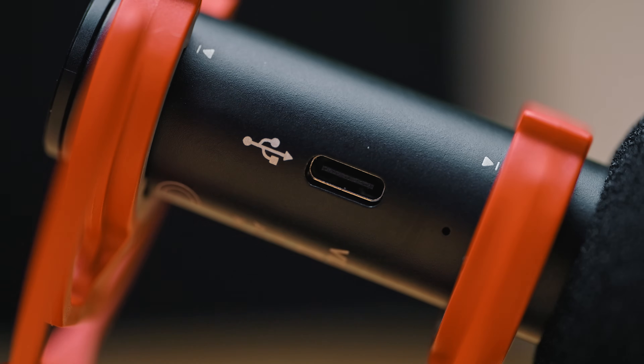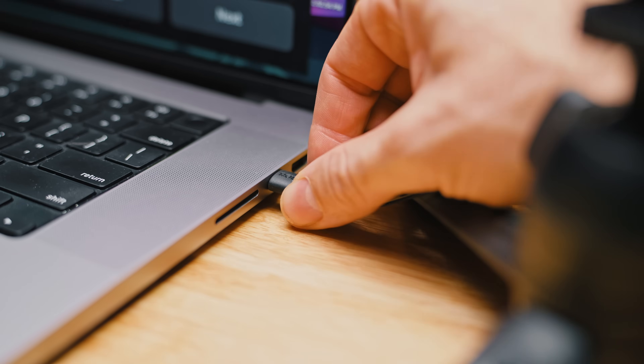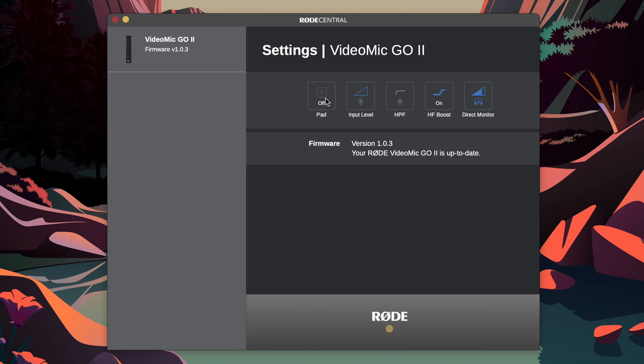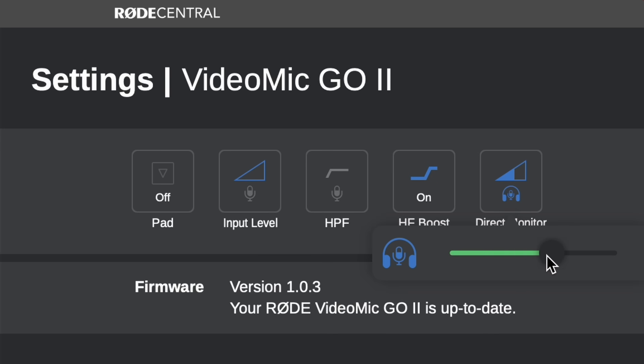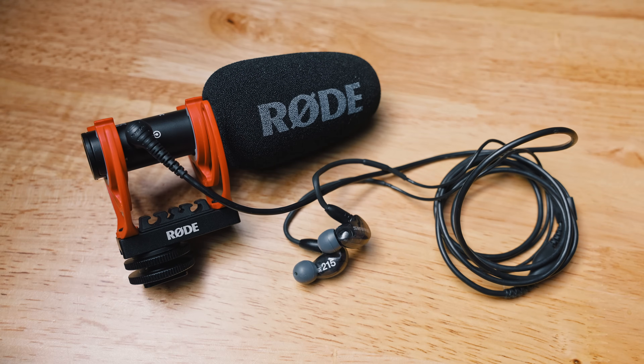There are some hidden features you might not notice right away. For example, if it has no battery, why is there a USB-C port? With the right cables you can connect this microphone to your computer and use it as a USB microphone for your podcast or video conferencing. When connected to the Rode Central or Rode Connect app, there are those bells and whistles we thought we were missing: a pad, input volume control, high-pass filter, a high-frequency boost if you're using a windscreen, and headphone volume — because you can plug in your headphones into the 3.5 millimeter output and hear the microphone with no latency, plus whatever's going on on your computer.